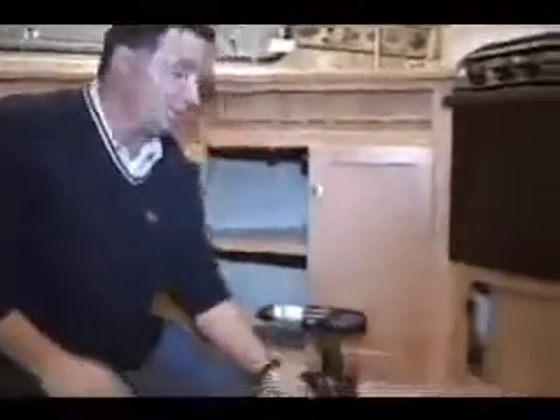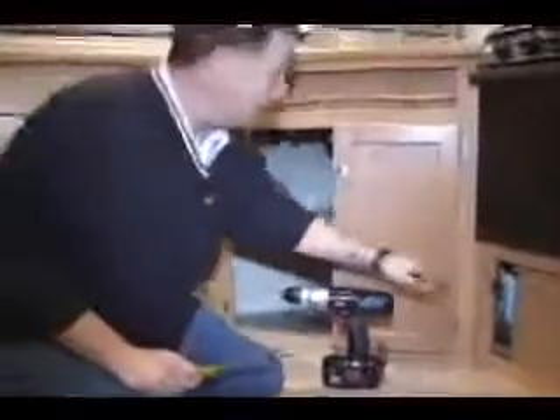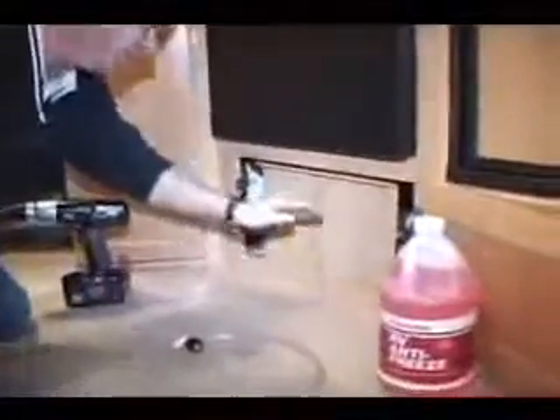I'm around the inside now. At this point I'll either take my screwdriver or my drill gun. There's a square head screw that's normally in here, and I'll take that out and remove the panel. Back in here I have my pump, and my hot water heater — having to remove this one — is back on this side. What I first want to do now that I've drained my hot water heater is bypass my hot water heater.